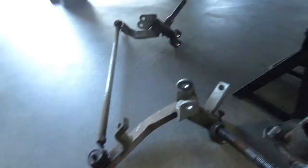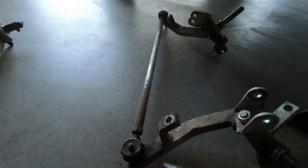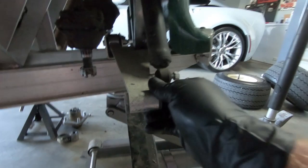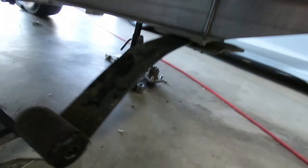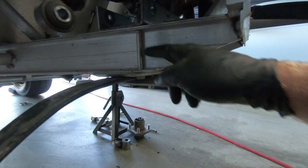I was unable to get this apart — I couldn't get this drag link bar out, so I'm going to have to knock these loose later. Our next step is we're going to take off the upper A-arm — just some 9/16ths, two bolts and two nuts on each side. Set those aside because you will not be reusing these. Now the last thing we need to uninstall is the leaf spring. There are four bolts that hold it together and you are going to be reusing those 9/16ths. We're going to knock those out and this will all come out of the bottom.